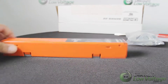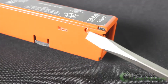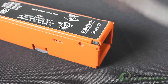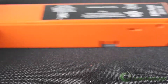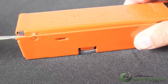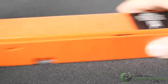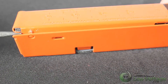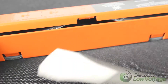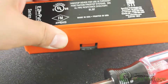Let's crack it open. We're just going to get a screwdriver here — you'll notice it's got a little indent here, same on the other side. We'll go ahead and loosen it, then get in at the middle where there's a little gap. Once you've got it open to a certain amount, we can crack it open. On the other side there are a couple of latches, and there we go.